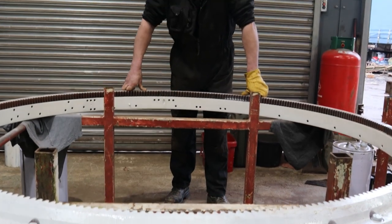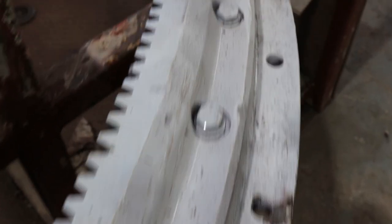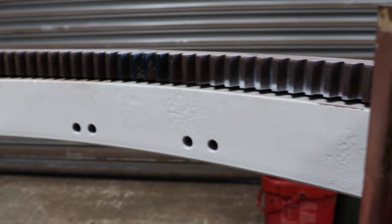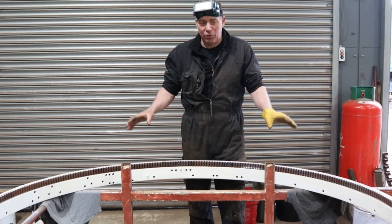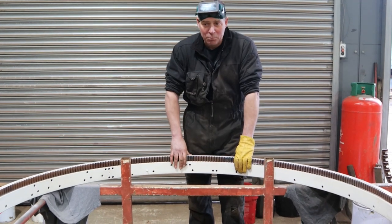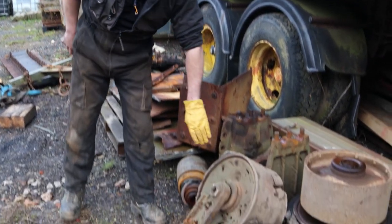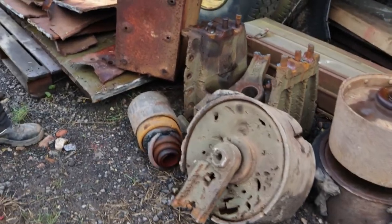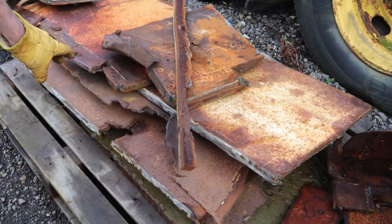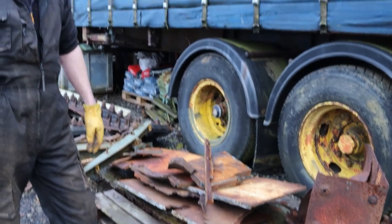Here's one of the biggest parts of the project — this is actually the turret ring. This is where the turret sits and traverses, so it's all full of bearings, but this was very, very damaged. We've repaired it, put new bearings in it, and we have actually dropped the turret on and it did work. We're just hoping when we put it back on the main hull and put the turret on — which will be weighing in at nine tonnes — that this actually still works. Fingers crossed, because if it doesn't, this is a £15,000 bit of kit that we'll have to find from somewhere else. Here we have some of the bits that we've had to take off — masses of damage, but we have managed to strip some of these parts for spares. Some parts are just so far gone it just wouldn't make sense to reuse them, though we've reused everything that we possibly can.